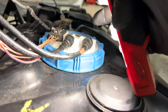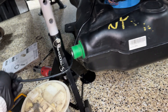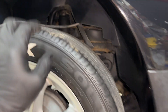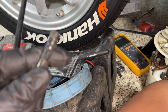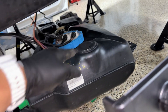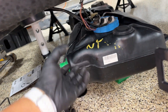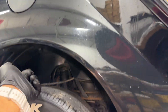There's a center vent pipe — I made a mistake and cut it, but thankfully this junkyard tank came with one. That center vent goes up to your fuel filler neck. I've got to take the tire off, take the plastic cover off, pop the old one out, and hook up the new one. I cut it out of ignorance — didn't realize what it was, first time doing this. It's a vent so that when you're pumping gas in, pressure can come back out and you can actually fill the tank without a pressure buildup.